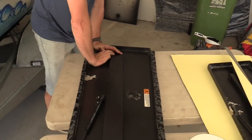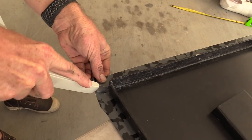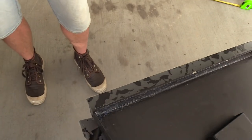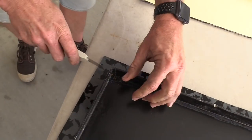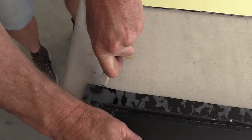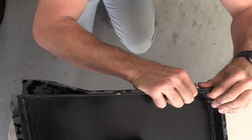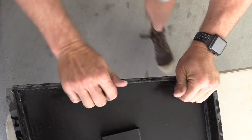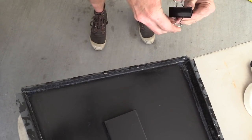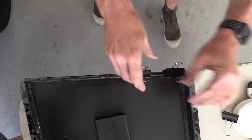Once we've pushed it all down, I start notching the corners out — just like marine carpet. That's when the bulldog clips come into play. The blow mold tables are good to cut into with a Stanley knife. It's just a matter of bending the diamond deck up and around and finishing with an ample supply of bulldog clips. If you don't do this, especially on a hot day, it can let go in the initial phases.